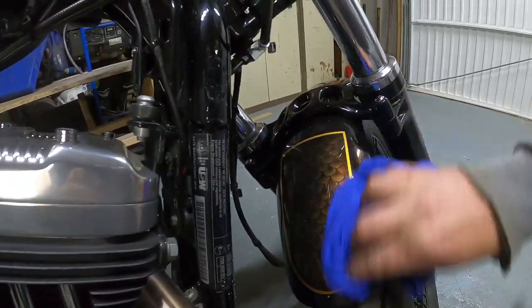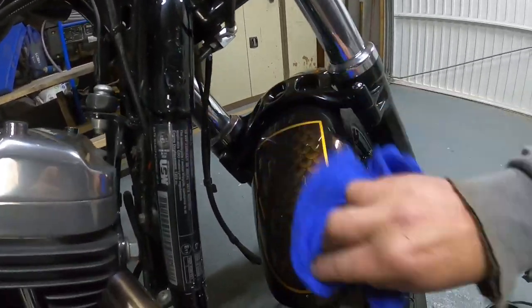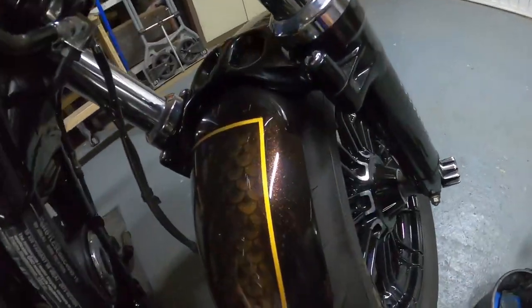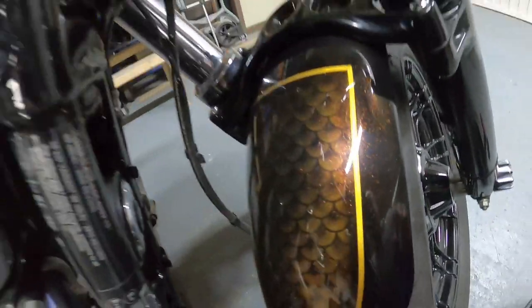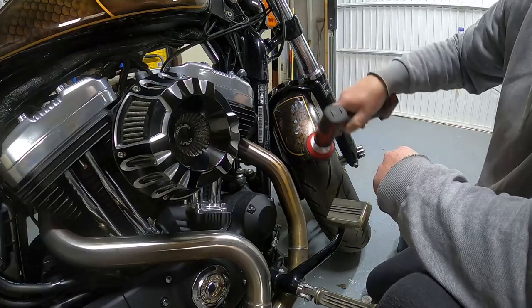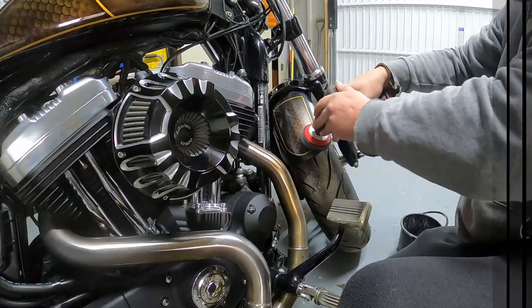And there you go, so where we sanded down, the depth of shine is back in the paint. Beautiful. So the next step now is to go over with the finer cutting compound. And this one is the Evo 3 renovation compound, so it's a little bit finer.